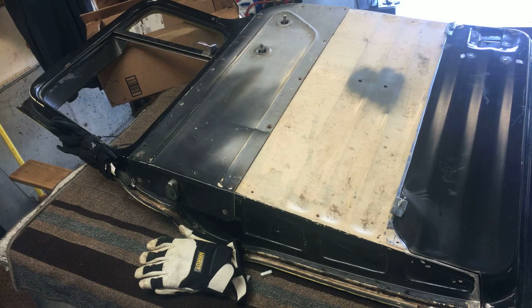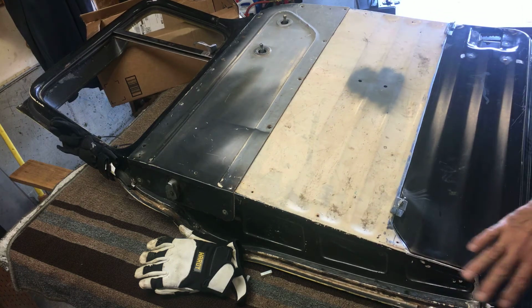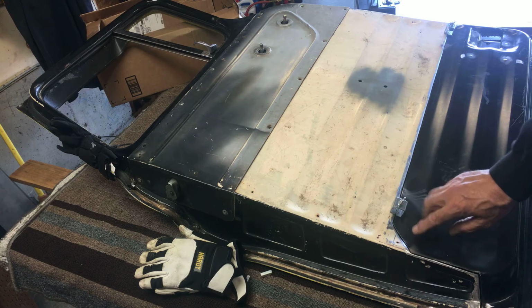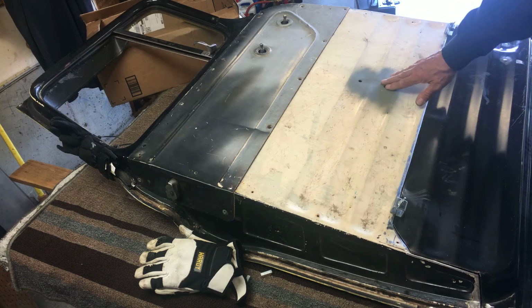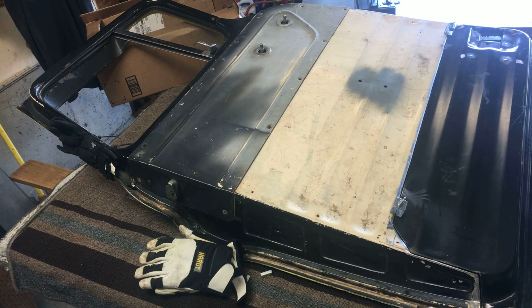Okay, guys, well, I've refitted this and done all the work I need to do for a final weld, other than I've ground the door all the way down. I just have to grind around this inner skin, and I've got to put this window track stuff in before I can attach this. And so the next video will hopefully be finishing up the door.